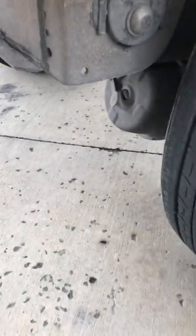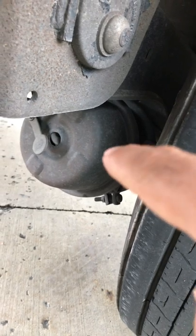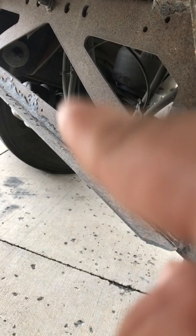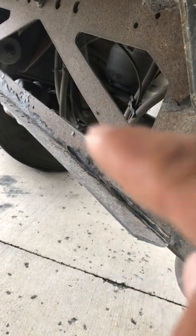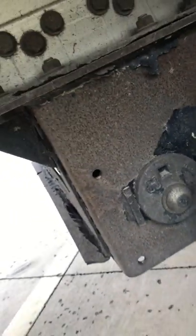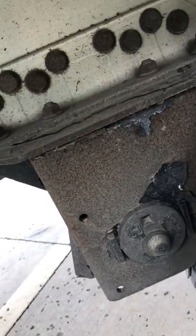You're going to say not leaking because it's not air. Then you go to your brake chamber right over here, properly mounted and secure, not cracked or broken, not leaking air. Right over here you got the air hose, properly mounted and secure at both ends. You got the spring mount, properly mounted and secure at both ends, not leaking air. Spring mount, properly mounted and secure, not cracked or broken.